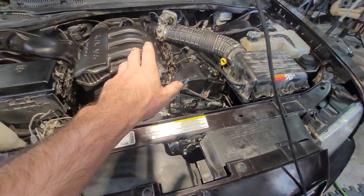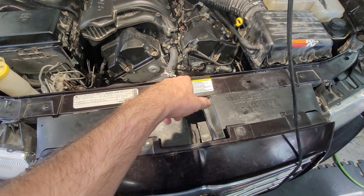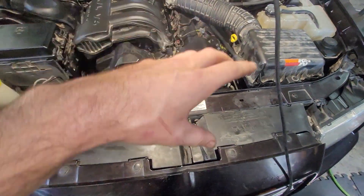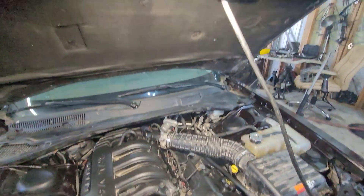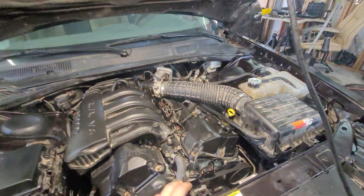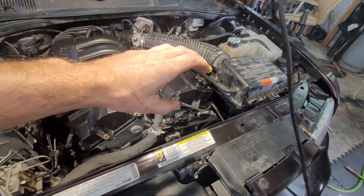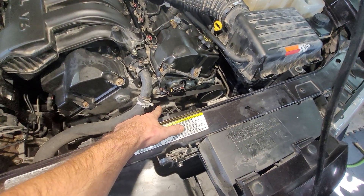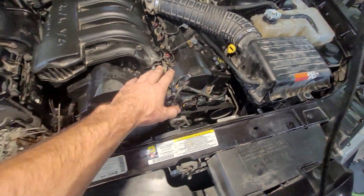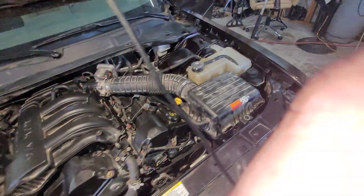This is the first one of these I've done — it's kind of similar to a Pentastar. I was worried about maybe skipping a tooth on the crank pulley while I had all the timing components off, but I was able to pull the cam gears off and suspend them from the hood to keep that chain tight on the crank pulley. I should have marked the harmonic balancer against the timing cover the same time I marked my timing marks on the cams before I took it apart, but I didn't do that.